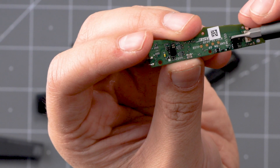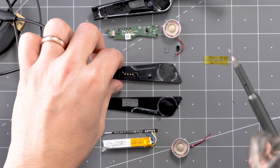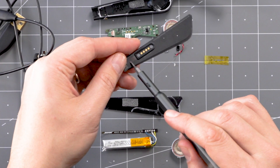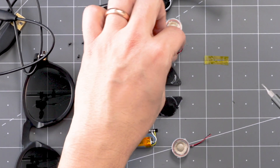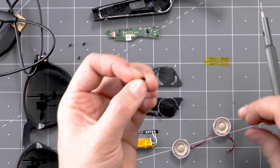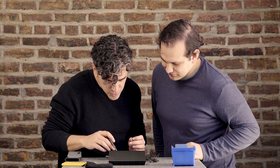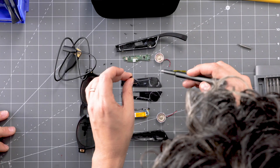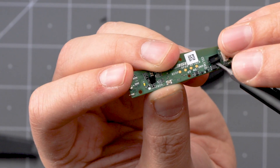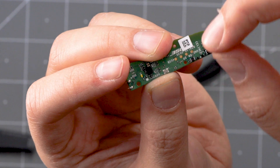There's a single microphone over here picking up audio for your voice. It has two holes on the inside — we're not audio engineers, but it seems to allow for increased air movement, like a tiny speaker. It was covered by a super thin membrane, and there's a rubber boot around the microphone, which is used to protect against water ingress and to isolate sound.